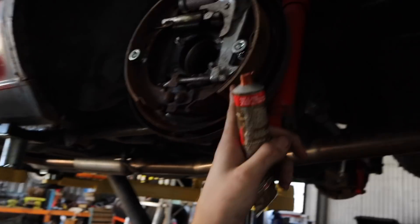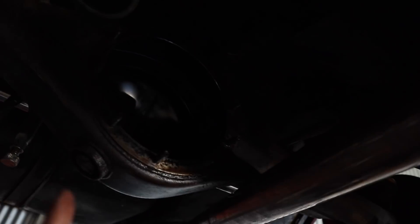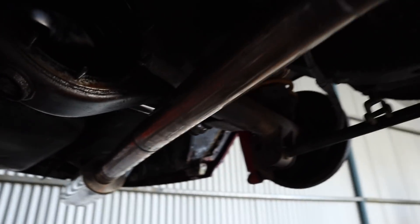If you've never pulled a Corolla diff out before, it's pretty easy. Pull the drum off - there's four 14mm bolts on each side to get that out. Pull your axles out, and then there are 10 to 12 bolts in here holding your center in under your tailshaft, and then it comes out. I'm just gonna copper-max the diff center, throw that back in, put it all back together, and then hopefully my sump is ready so I can get that back on.